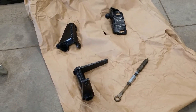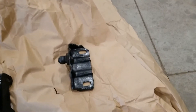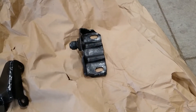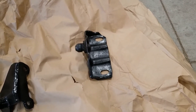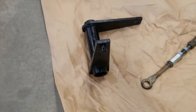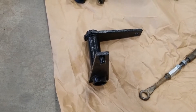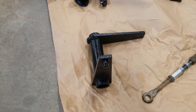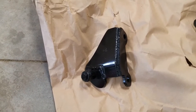Here are the crucial parts and pieces you're going to need. In my pickup's case, it was set up with a 360, so this is actually the factory bracket that bolts to the frame for the Z-bar that works in the 360 setup. This here is that factory Z-bar, and it's set up in such a way that it's pretty easy to repurpose — in fact, I didn't have to make any modifications to it. And here's that bracket that bolts to the back of the bell housing.